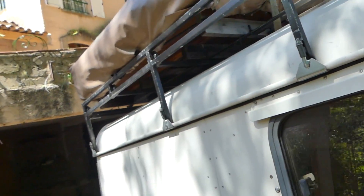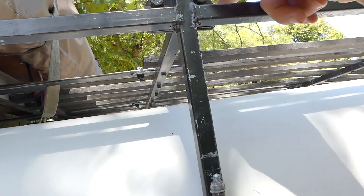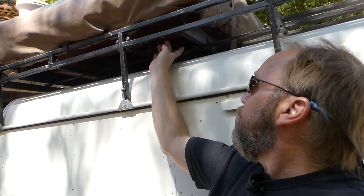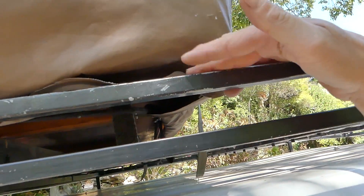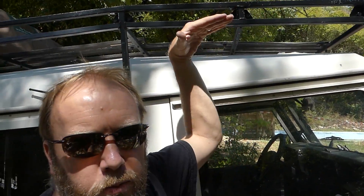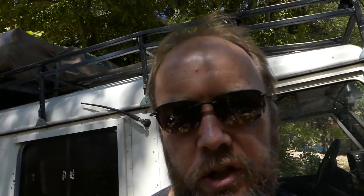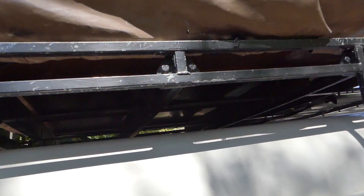The main reason I modified it is our roof tent — it's 140cm wide, and so is the roof rack, so mounting it on the side rails wasn't going to work. What I did was cut these down as much as I could, to about the height of this bracket with the bolt holding the cross member on. I then mounted the roof tent on some boards — some planks about six centimeters high — so we got a little bit of room between the roof rack and the bottom of the tent. I followed the profile of the front bottom rail, which dips along the roof line, and did that with the top as well — and I'm pretty happy with that.